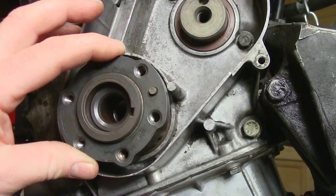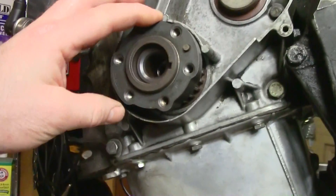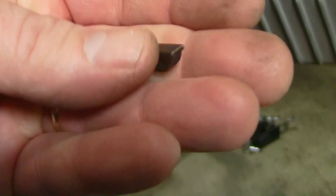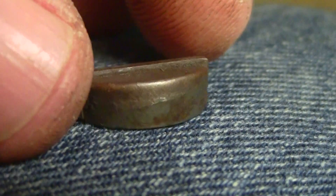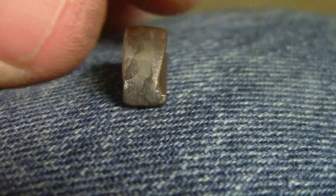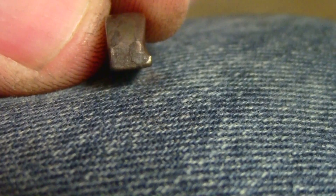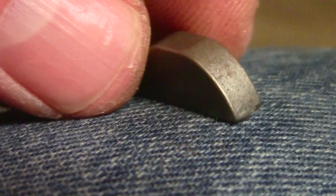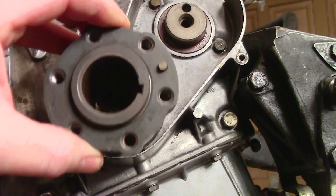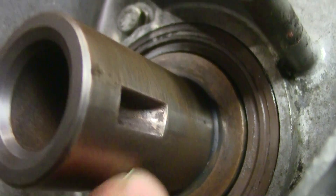How could that be all right? There is a lot of play in this keyway and that's not good. I've already had this apart so I can show you what the problem is. This is the key that was inside of the keyway and you can see that it is significantly worn. That shape is not the shape that this key should be — this should be a five and a half by six millimeter key. But the really crappy thing is that it's caused a deformation to happen, and I want to figure out how bad that deformation might be inside of the crank.